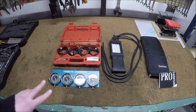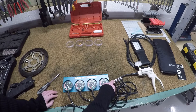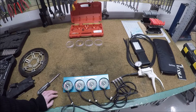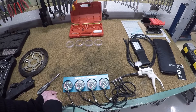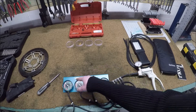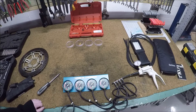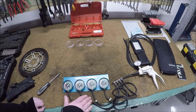Let me show you how I'm going about calibrating these. The way I'm testing is to run every one of the lines to a four-way splitter — a piece I forgot I even had from my aquariums. I realized I could break the vacuum pull evenly four ways off of a MightyVac, which will pull a consistent vacuum across all four gauges. So when I give it some vacuum, all of the gauges should move and I want them all to read the same.